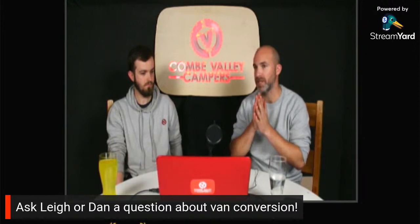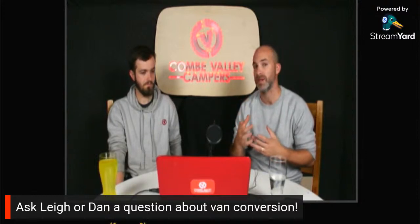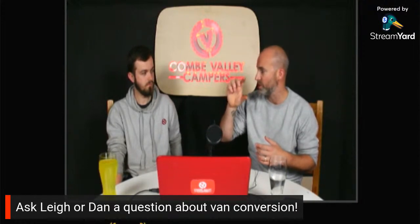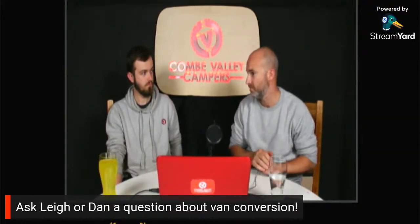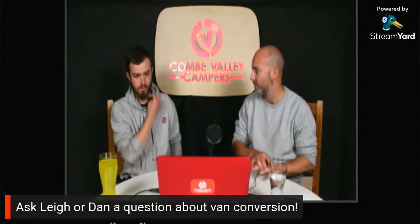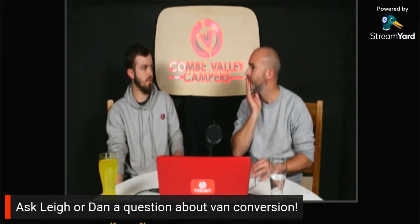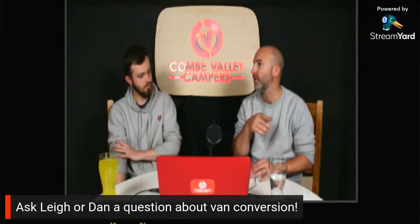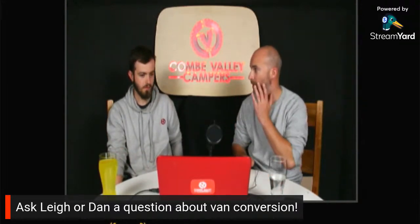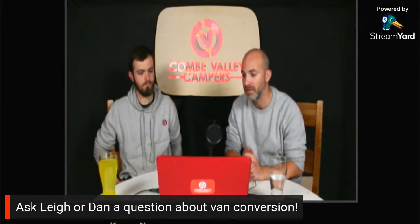But what that means is, because that rear threshold cover is designed for either a Caravelle or a higher spec Transit people carrier, the actual depth between the top of the threshold and the floor is like 18 to 30 mil. It's quite a deep step. We had to pack it out with flooring and insulation, didn't we, to make that threshold match, when we did the combi van version. We had to raise the floor anyway to match the seat brackets, because the seat brackets are thick, aren't they? So I don't think anyone's doing a decent aftermarket rear threshold, I'm afraid.